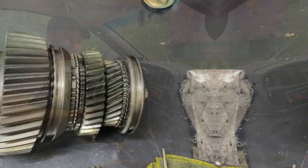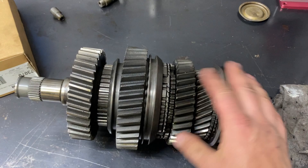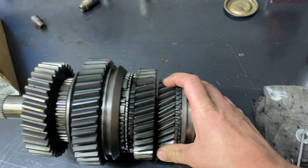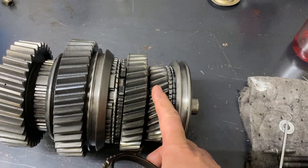Here's a brief description of what's happening in your transmission when it gets all gummed up with old fluid. Here are your gears and the main shaft of the transmission. These gears spin freely on the trans main shaft until a collar goes over and locks the gear to the shaft — that's what puts it in gear. The gears have a rounded ring surface, and as you push your slider in, the synchro pushes against that material. The synchro has fibrous material on the inside that stops the gear and makes it go to the same speed as the main shaft.